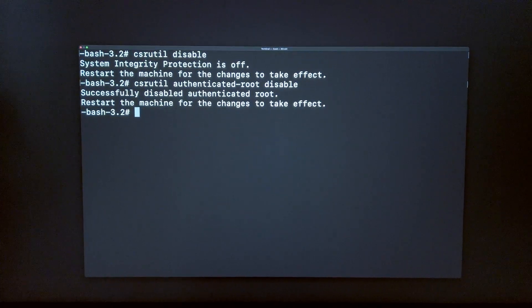You don't want to re-enable either of these things after you've used the script. If you find that you need to switch them back on, then first of all you want to uninstall Purge Wrangler. Once you've done that, you can reboot the machine into macOS, still with the eGPU disconnected, and now you can run the Purge Wrangler install script as per the instructions on the page. If you're using an RX 5000 series card, like the 5700 XT, don't let the script do an auto-detect — that will crash your Mac. Just set up the eGPU manually. It's really quite simple. Once you've done that, you reboot the system again and plug in your eGPU.